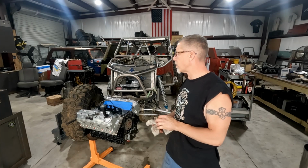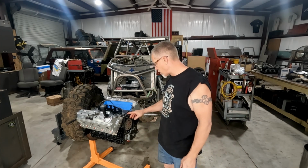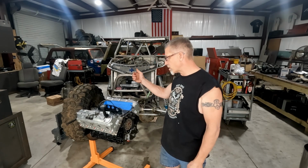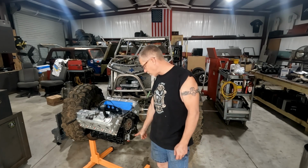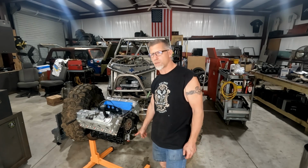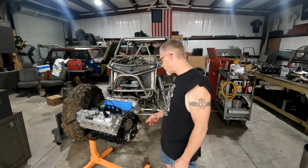So I'm gonna take care of those couple of things. Tomorrow when we get back out here, we'll get the oil pump installed, we'll get the front cover installed, all of the front accessories on it, and we'll actually be pretty close to being able to install it. I don't have the crank bolt. They are 100% replacement. Every time you take one out, you got to replace it with a new one. One-time use.